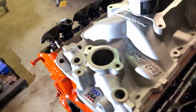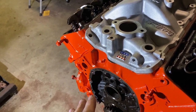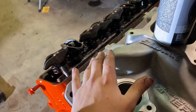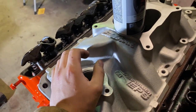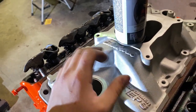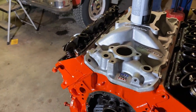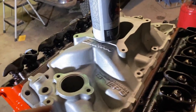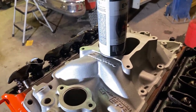But what that allows a guy to do is, once he paints it that color, it's a lot easier to clean. Like this raw aluminum, you drip some gas or some grease on it from your motor, and it just stains and doesn't come out unless you use an acid cleaner for aluminum, and then you're soaking the top of your motor, which is not very good. And especially if you have to use an acid cleaner, it's going to dry out your rubber seals and your carburetor, and I could go on and on.